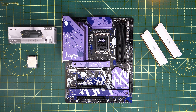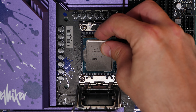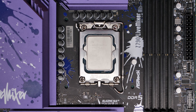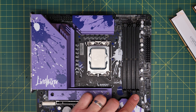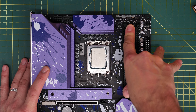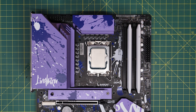For the motherboard setup I'm using an ASRock Live Mixer Z790 along with a Core i9-14900K CPU from Intel. Gently seat the CPU down into the socket, lining up the notches at the top and bottom, then put the lever down to hold it in place. For RAM I'm using Crucial DDR5 Pro Series — use the second and fourth slots (A2 and B2) to make the most of XMP. Using four sticks of DDR5 is still pretty unstable, so I'd recommend getting two where possible.